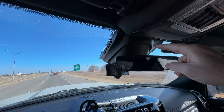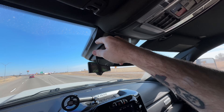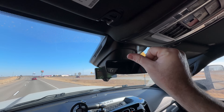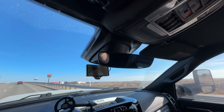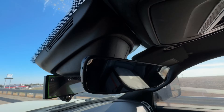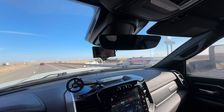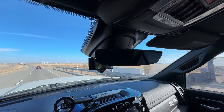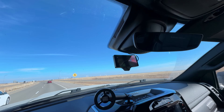Once you have this cover off, the whole thing will come out. Your harness adapter goes right here — you'll unplug the one that's there, plug your new one in, and it's very simple. There's a little sub-adhesive tape to hold the cable. What I did was take this cover into my shop, drill a quarter-inch hole at the bottom of it, and cut around it to make a U-shape, so I could run the cord for the Comma out.